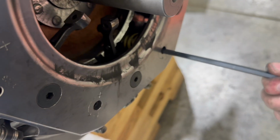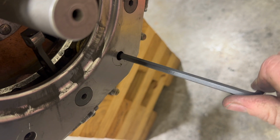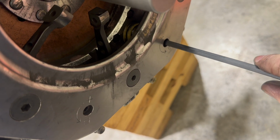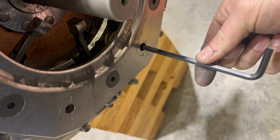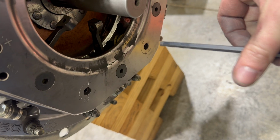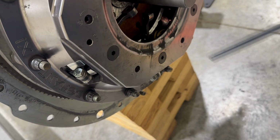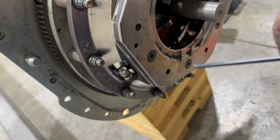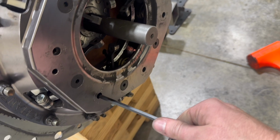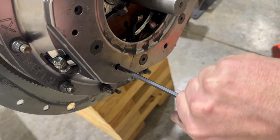So right now I'm taking pressure off and zeroing everything. So I am going the opposite from the left. There's our reverse thread. And then just go until it's got a loose spot, and then it stops. So I'm gonna start there, and it was at 2.5 turns of base. So I'm probably gonna put like 4 turns of base in this thing, just to get it on the dyno. Maybe even some more, 4.5, 5. Put some good base in it. But good lesson on what exactly is going on when we say base pressure adjustment, so you guys understand kind of what's happening under the car at the track.